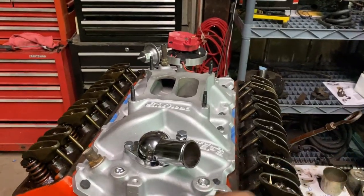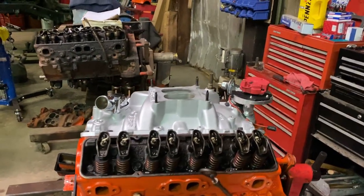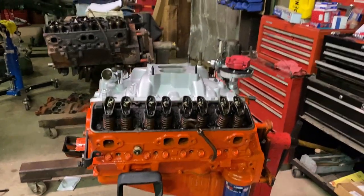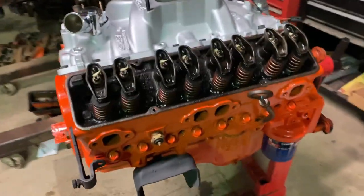That being said, that'll be a wrap today. We got the valve springs in. We got the intake on. I wanted to get the valve covers on, but the bolts and hold downs for the valve covers, I didn't have painted. My fault. Oh, well. In the next video, we'll throw those on. And once we get the valve covers on, I just got to throw the lift plate on and, oh, the harmonic balancer. And other than that, then it's ready to go in. So we got a lot done today, though.